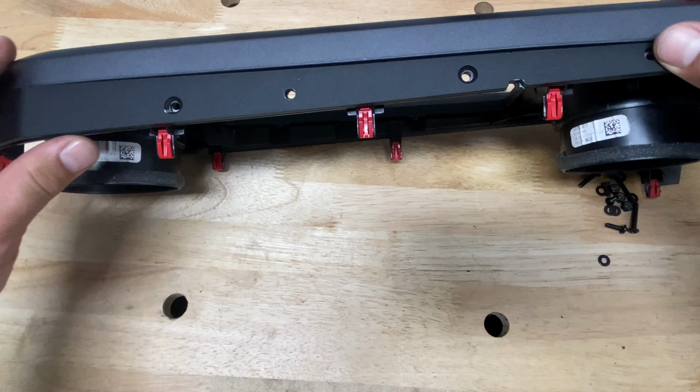This has a little brass deal with some teeth, and it goes between your radio bezel and your dash mount. It'll cinch the plate to the radio bezel real tight here on the corner. And in doing that, it provides extra stability. Now, had I known that, I would have taken this whole dash apart again, like I'm gonna do right now, and I'm gonna show you.